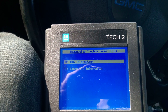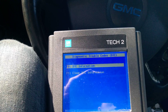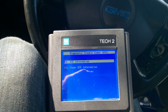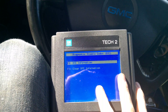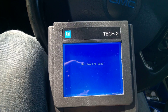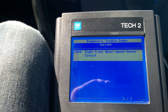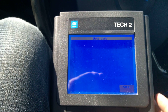The sensor I unhooked is the right front, so I should be getting a C0040, which is for the right front. If it were the left front, it would be C0035. With this code, especially if you have another issue where the sensor is not gapped correctly — there's a how-to on the forum for that which I'll link to — we're going to go to DTC Information and then Current Diagnostic Trouble Codes. You can see it says C0040 for the right front wheel speed sensor circuit, exactly as expected.